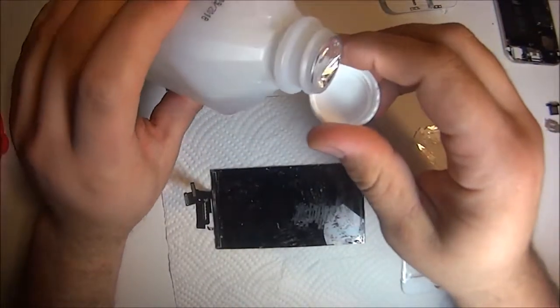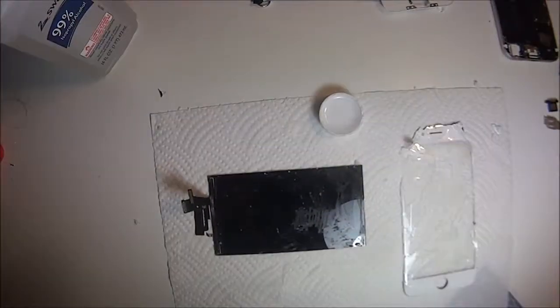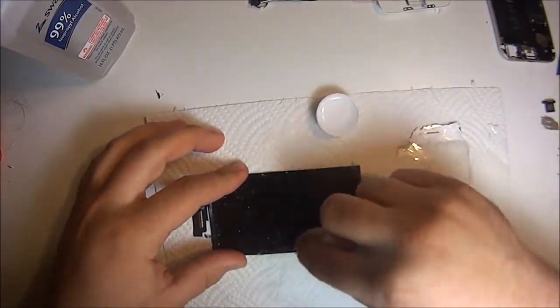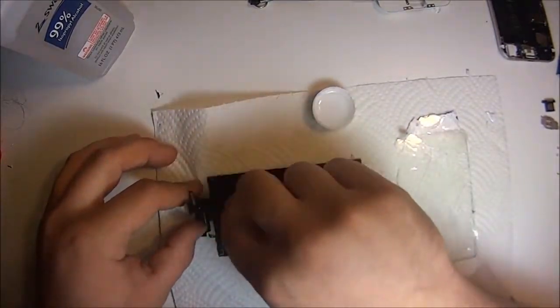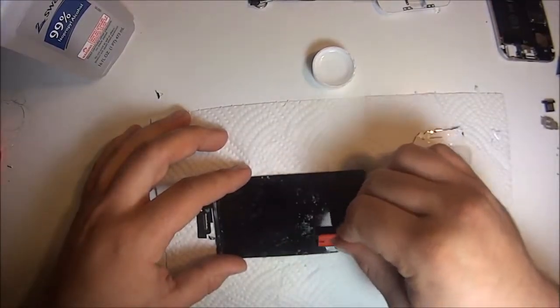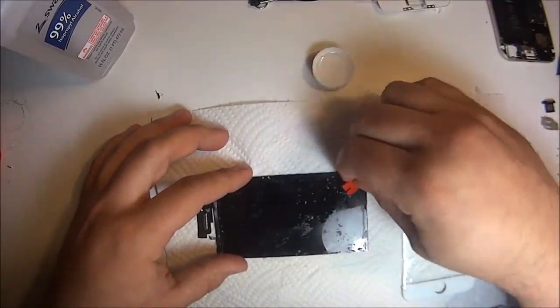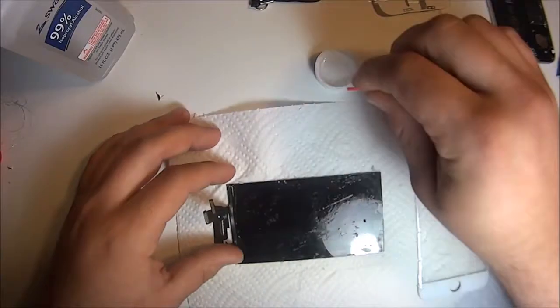Behind the LCD, there's something called a backlight. Can you change it? Yes. At that point it just becomes difficult, and you need a soldering pen, and this is supposed to be a do-it-yourself kit. So when I tell you to use the alcohol, use it. Dab your paper towel in the cap and just clean it. Remember that alcohol dries fast, so it's not going to really run into the back unless you're pouring it on there.